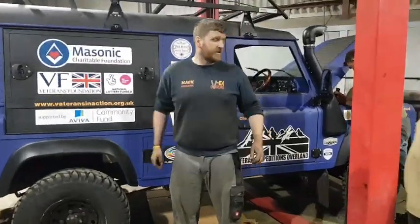So what have you done today, mate? Tell us about your nightmare day. My nightmare day started with an ignition switch that was draining my battery. It was terrible. So what happened was I tracked a fault back to the ignition switch where the positive and the negative across the switch were touching. Found this out by putting a voltmeter on my battery and watching it count down like a stopwatch. And as soon as I undid all of the ignition leads, it stopped counting down.